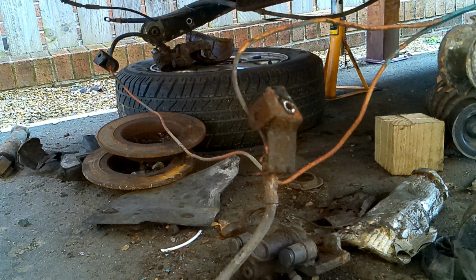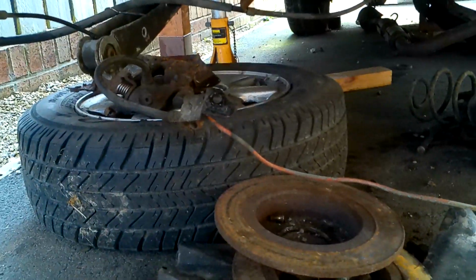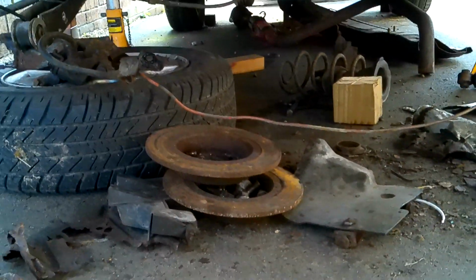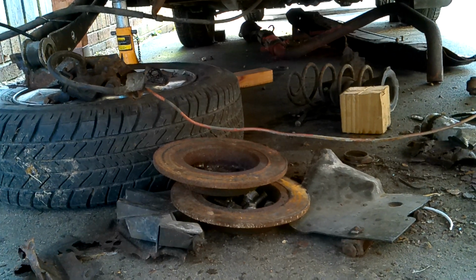So you saw I was practicing using the brake flaring tool. So what we're going to do is go to the front, cap off the ABS, mark up which pipe is left, which pipe is right, disconnect them. There'll be a bit of drain because obviously the pipes will have fluid in them, and then we can start to pull through and shape the new brake lines. So let's go and take a look at the ABS pump first.